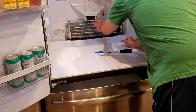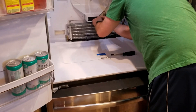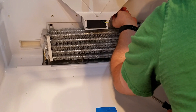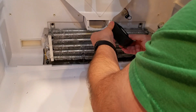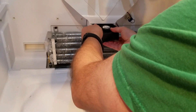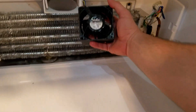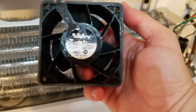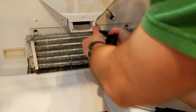Make sure your power is off. This is our problem here. I'm going to loosen these wires — they're kind of in a harness and wrapped around this plastic shroud. This is the offender. Remember how you pulled it out because it goes in a certain way. Zoom in on that — you can see the original part number: WR60X10356. Made in China. That might be our problem there, but this is what we're pulling out.